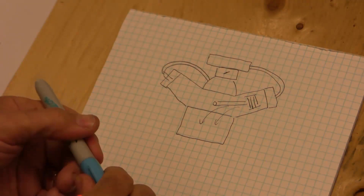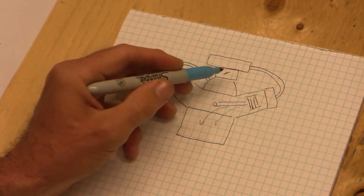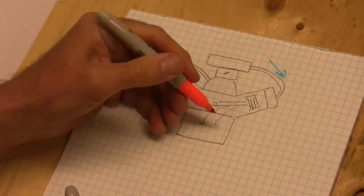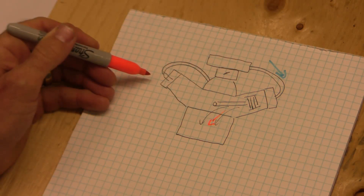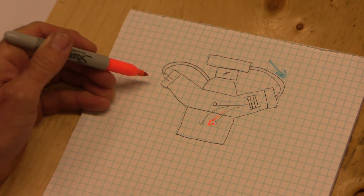For you to understand how this works I need to review the PCV system. The breather tube is here, coming from above the throttle butterfly. This allows free air at atmospheric pressure to be passively drawn into the crankcase. That air cools and dilutes the blow-by gases that leak past piston rings. Up here is the PCV valve, designed to be wide open when vacuum pressure is low at full throttle or when the vehicle is turned off. At idle, when manifold vacuum is high, the PCV spring is pulled partially shut by the vacuum to restrict flow. When designed this way, the PCV flow fairly closely matches blow-by gas production without causing vacuum leak problems at idle.